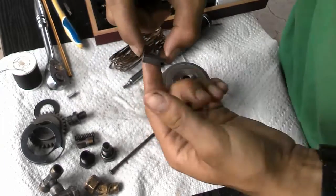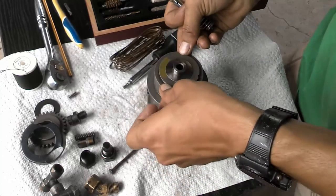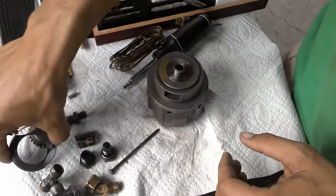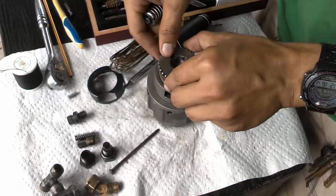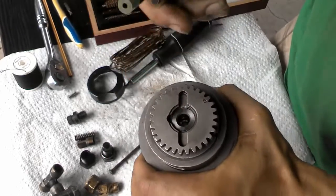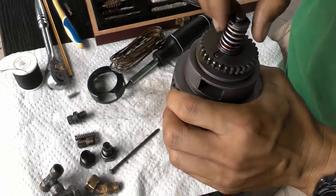Put your heads back — there's an indention on this side and none on the other, so I'm not sure which side it goes on. I'll ask Rob about that. There's no other indentions on the sides, so I don't think it makes much of a difference. The block — get the washer on first, and you're going to have to line it up perfectly, otherwise she will not want to go in. Twist it — don't push down on it, you will bind it. Also, this indention right here has to match up with this nipple right there, otherwise your double ring washer won't go flush and you're going to have a faulty head.